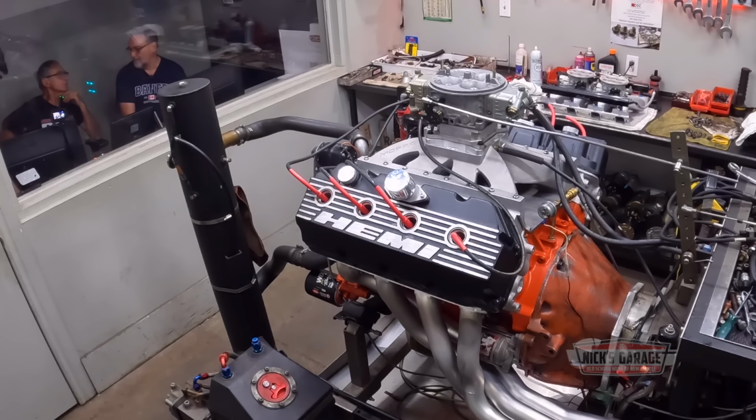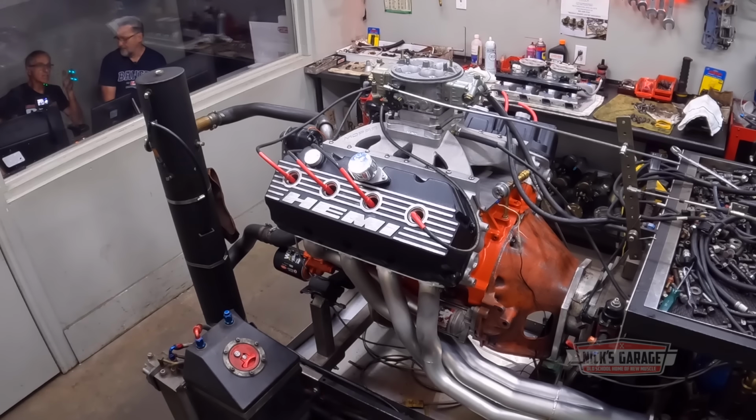So you selected all the parts on this engine? There's a guy at the speed shop. I know he suggests this and that, but that's what he had in stock. So, the motor, the block, Kelly block. I think they're all great pieces. It's a good choice. You went with the other block, aluminum heads, and that's one of my favorites, the block there. Yeah. 4.5-inch bore, brand new block. And of course, a roller hydraulic cam, which is a nice simple one.